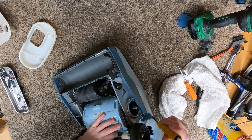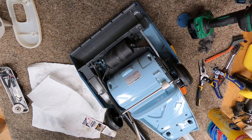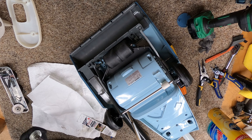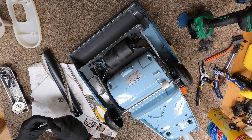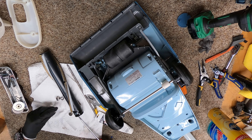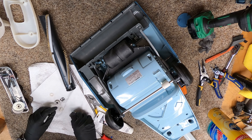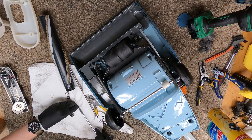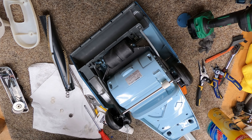Now we're going to put the height adjustment together. The height adjustment is just this rubbing on this wheel — shag being the highest. This just kind of rotates on here like so, and there are four screws where that attaches. Now, if you haven't seen any of my other videos on Hoover before: Hoover did not use sealed bearings on anything until they were sold for the second time to the Chinese, who actually made vast improvements to their machines versus under Maytag.